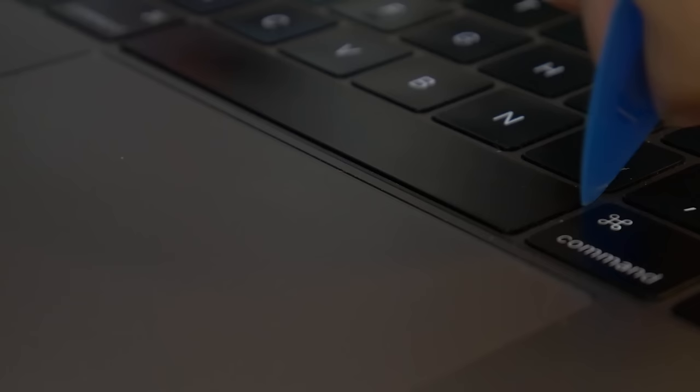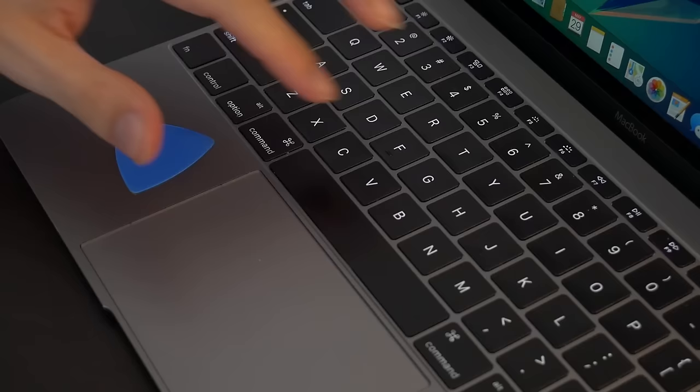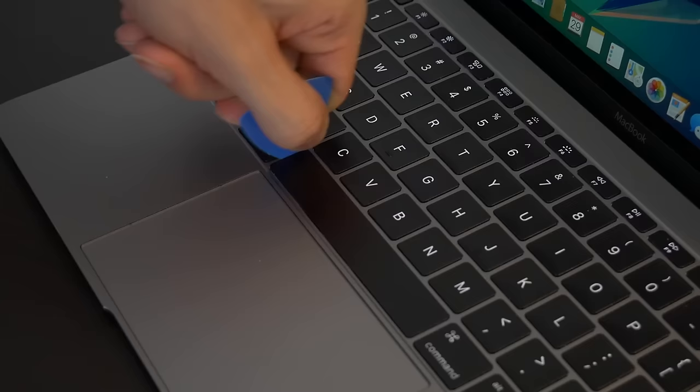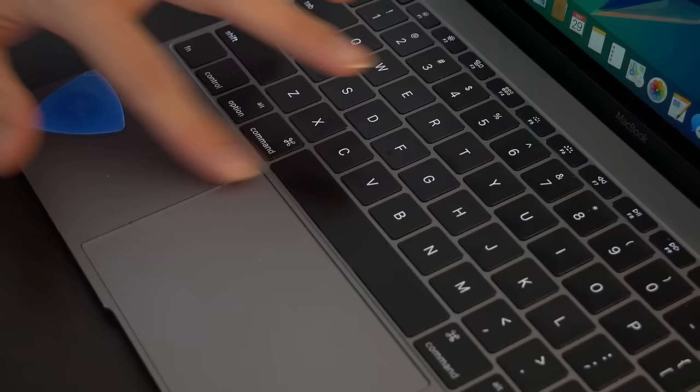That's really all there is to it — just go around each of the four corners with the little pick and test each side. I can tell this side is a little bit looser, so I'm going to try a bit more under here, really get it under there and twist it from side to side to get as much of the sediment loose as possible. That should fix up the problem pretty nicely. You can try that as many times as you want, just make sure you're careful — you don't want to damage the key switch or snap one of the keys in half.